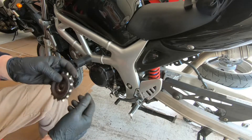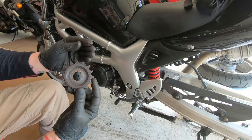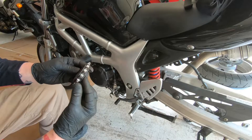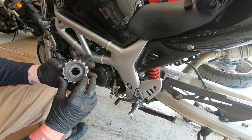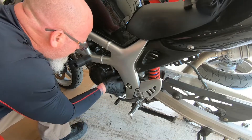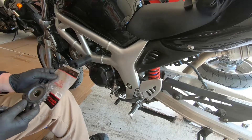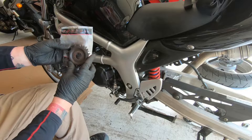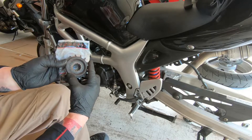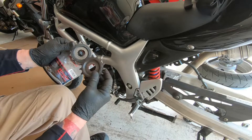Don't forget your little safety washer because we're going to bend this tab back over when we're done. You can see this sprocket is moved forward a little and rubbed on the inside - that's because that chain was old. This bike's got like 20,000 miles on it so I'm sure this is all original stuff. You can see the difference with the way those teeth are rounded off and bent forward a little bit. Like I said, we're switching to a 520.